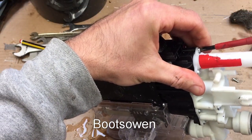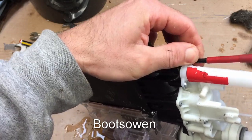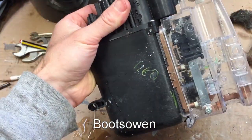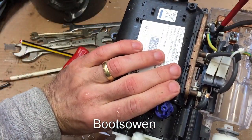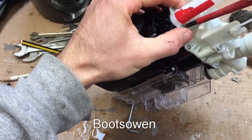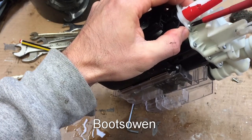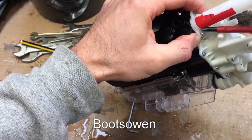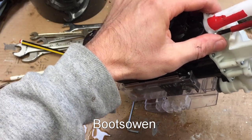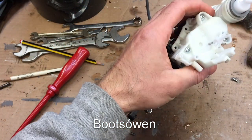Let's take off that outlet. You'd have to take it off the wall to start doing this level of dismantling, which makes me think that there's a thermal cutout in there — an overheating thermal cutout. You probably can't do that with it on the wall. But yeah, they're going more and more towards these kind of sealed units.